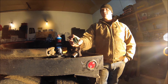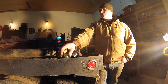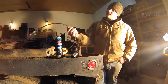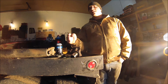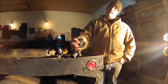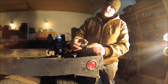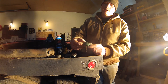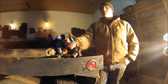For those of you that don't know what this is, this is the gear that drives your speedometer. What happened is at some point somebody let the speedo cable get up against the exhaust and it melted that cable. When it melted, it held the cable in place so it wasn't allowed to spin, and that took the teeth off of this gear. The outside teeth are fine but toward the middle it's all worn down. That's going to have to be replaced — it's like a $10 part, but the transmission had to come out of the truck for it to be done easily.